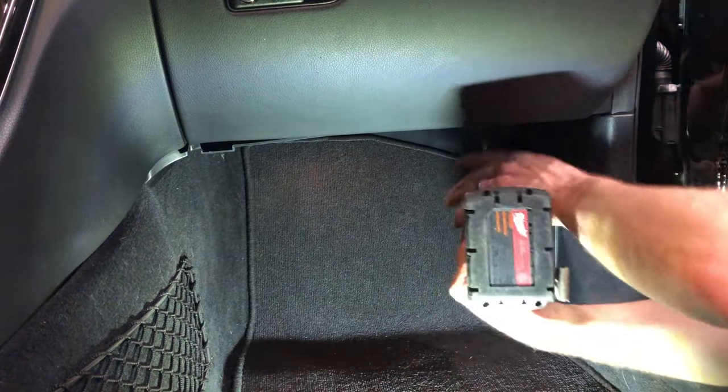This is the footwell area — I took the dome light out. Just up here on your airbox: this is our fan motor that was shown above, and then you have your charcoal filter here. I'm going to do the best I can at getting this filter out and showing you every bit of the way. This is a really simple design — it comes right apart. The filter you kind of have to crush to get it up in here, so bear with me as I have the camera in front.